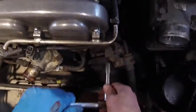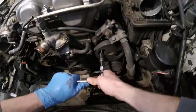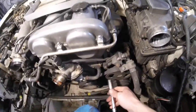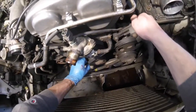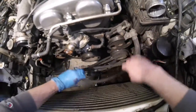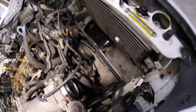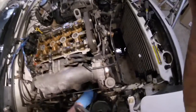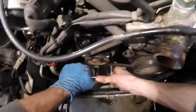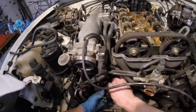Tension off this power steering — it's going to take two 14s. One's through this pulley right here, and the other one's right here. The alternator tensioner takes a 12 millimeter and a 13 millimeter, and it's kind of hard to get to but you can get a ratchet in there and get it out. Loosen this 14 mil on the alternator itself down here by the belt. We remove this alternator belt.